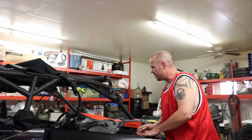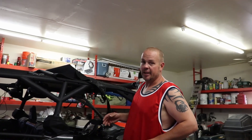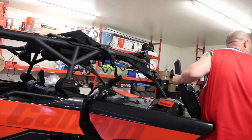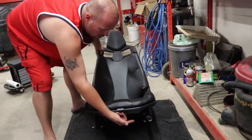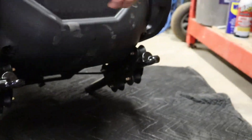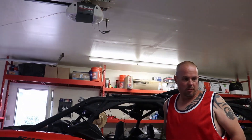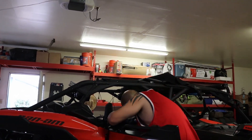Time to get the seats out — they're unbolted from the light bar video since we haven't driven this unit yet. There are two bolts that go one way and one that goes the other way in the front, then two bolts through the back of the seat with nuts. It's easy — just four bolts, plus the fifth bolt for the seat belt which is easy to take off with a wrench. Don't let it deter you; it's not that hard.